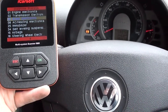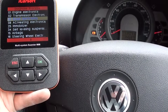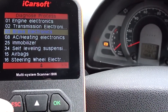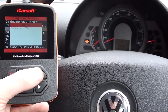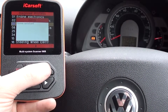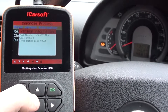The tool we're going to use to diagnose the ABS system is the iCarsoft i908 scan tool. It will diagnose ABS systems on VW, Audi, Seat, and Skoda. We need to be selecting the brake electronics here — we'll select that and it should connect to the ABS system, which will then give us a fault code and also a brief description of where the fault is. That gives us some information on the actual ABS system that we have here.